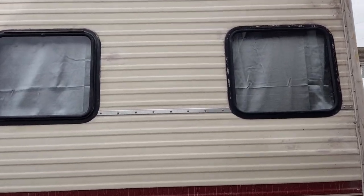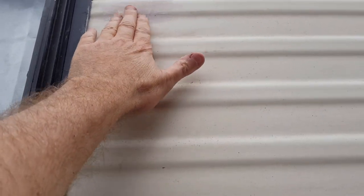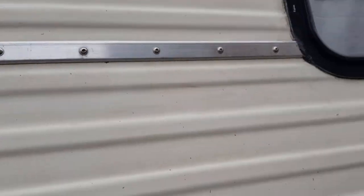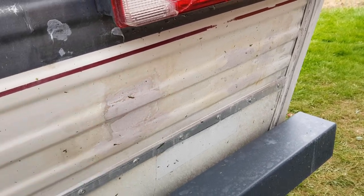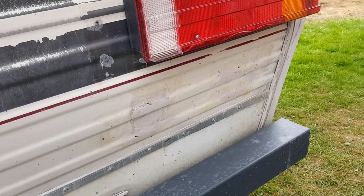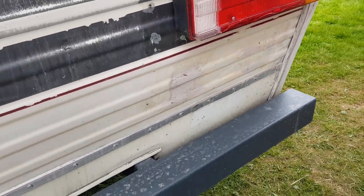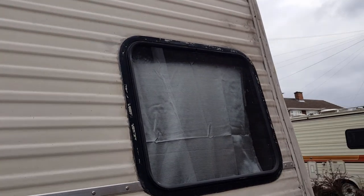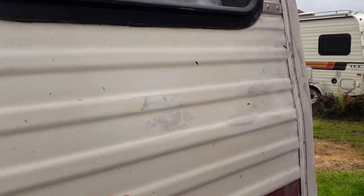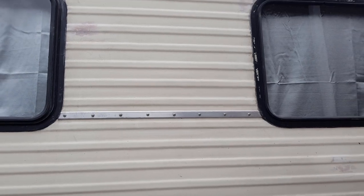There's a little bit of filler work on the back here as well guys — not a lot. Some up here, just a touch more to be rubbed down. Below the lights here, that side's not very good because the panel's not very straight, but we'll see if we can make an improvement on that. Yeah, the panel's a bit warped over that side. But other than the corners, the back panel's okay I think. That's nice and straight. The filling work's coming on very well indeed.